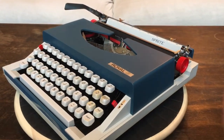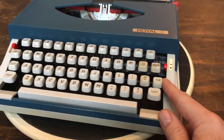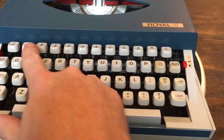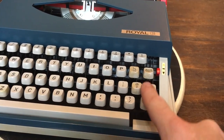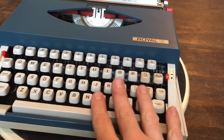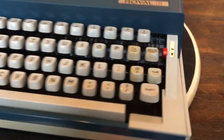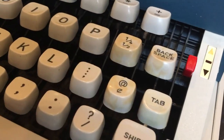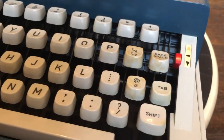The one thing we did have to do to this was take it all apart and clean it. The keys — and this happens on lots of typewriters, but Silver Seikos in particular — tend to get some yellowish looking keys. I retrobrited them with hydrogen peroxide, so most of them came back to gray. There are a couple that just couldn't come all the way back, so they actually look like kind of yellowish-whitish keys. So, Colby Jack, I guess, to go with your Royal Sprite.